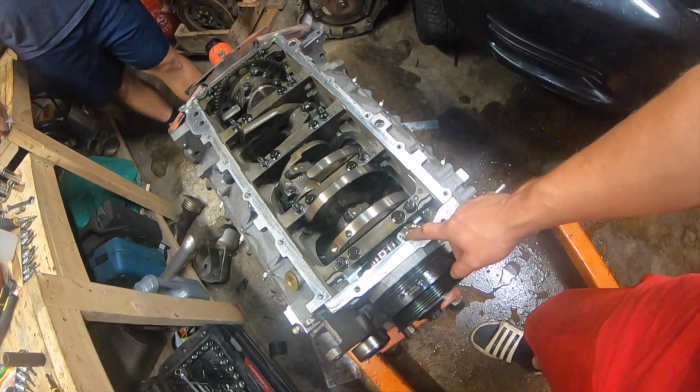I'm not going to touch anything on the bottom end on this. I think it's all good. I'll probably do a little more inspecting and stuff, make sure I don't see anything else. And if everything's good, I'm going to put this back together, and I think I'm going to let the car sit until I can sell some stuff and get probably like a 3200 Circle D stall for it, because I really don't want all this to be for nothing. So if I could put it back together with a new stall, I'll have those flex plate bolts Loctited in so they don't come back out. I'll have this oil pickup tube tightened the way it's supposed to be.